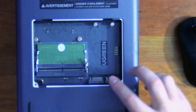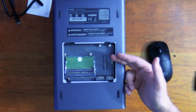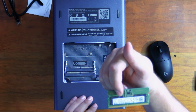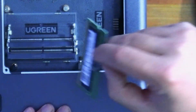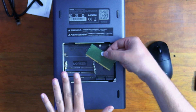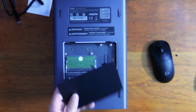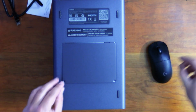There's no reason to put a Gen 5 drive in here since the slots are Gen 4. To remove the memory, just pinch the clip and it pops out. The current installed memory is Samsung DDR5 at 4800 MHz — not a high frequency, but that's appropriate for a NAS. To install new memory, just line up the slot with the teeth and push down until it pinches into place. Then just re-screw the bottom panel.